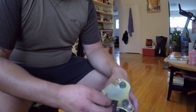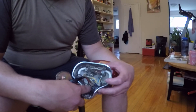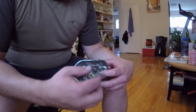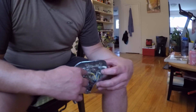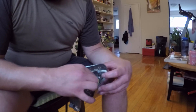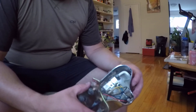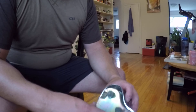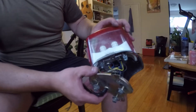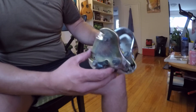This wasn't difficult to do - you just have to do some tracing and pull apart the connection. Because of the magic of cinema and time-lapse photography I've already installed the interrupter or strobe flasher. On Yamaha the yellow wire is the brake light and the blue wire is constant - that's the only difference. Black is ground. You can try and finagle if you want to wire it in there, but you can't really get to the wires that way.